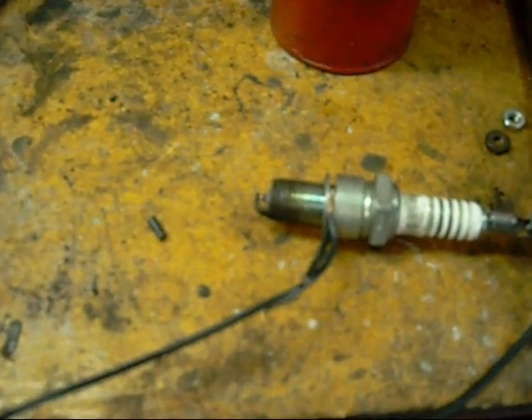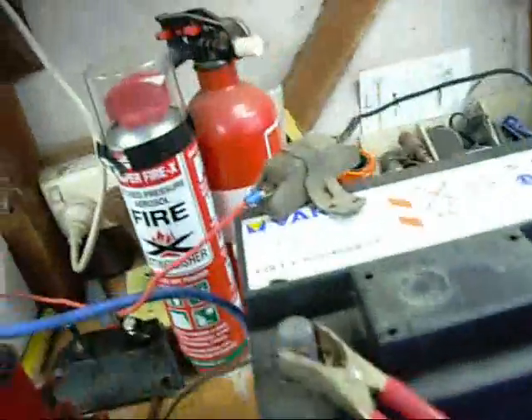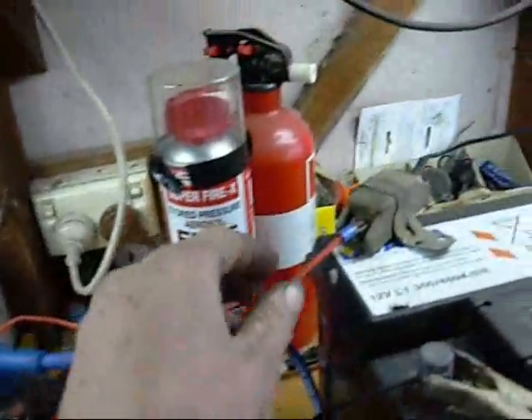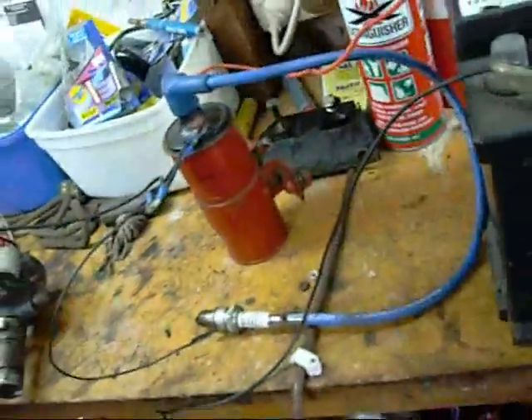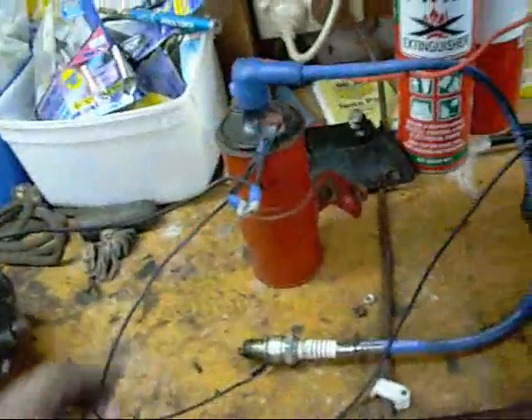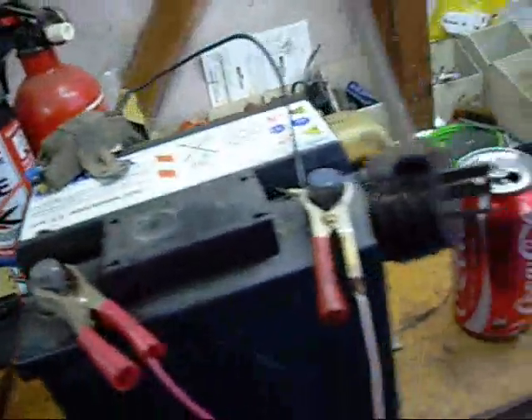Funny connection here so it's a bit erratic, but it is working. I'm also using a ballast resistor — it sort of halves the voltage going to the coil so that they don't boil, particularly when the points are left shut. That's always wise — if it says 'use with resistor' on the coil, use it with a resistor.